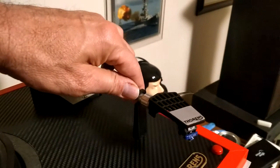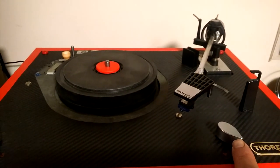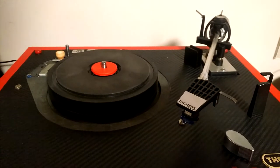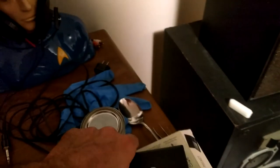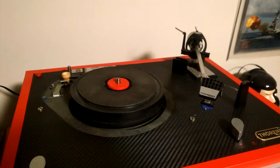That is 1.5 grams on the stylus plus 0.25 grams taken up by the extra drag of the carbon fiber brush on the stylus guard - that is how you basically balance the tonearm. Once you put the external platter on, lift the cue lever so it holds up the stylus, then drop it. It won't go all the way down now without the platter, but once the external secondary platter is on it will play on the record. You can confirm the weight using a digital scale, which I find quite accurate.